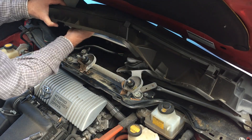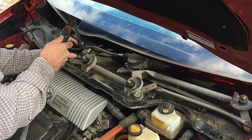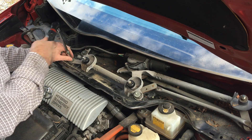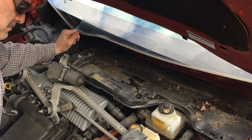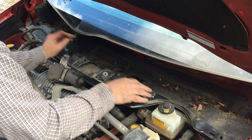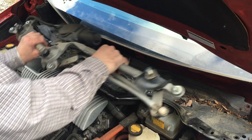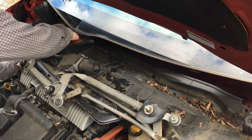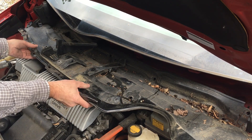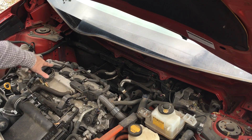I'm going to try to flex up on this. So I'm going to have to unbolt this wiper assembly too. I was hoping to get this down and out of the way without removing these clips, but that's not going to happen. I'll sit this down first, then pull this out and sit it off to the side. Pull the engine cover off — I can see my coils right here and the spark plugs under them. That's what I'm going to change next.